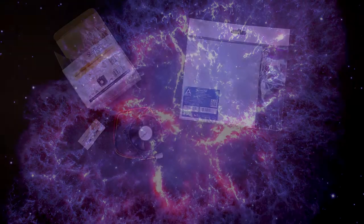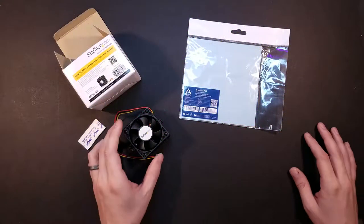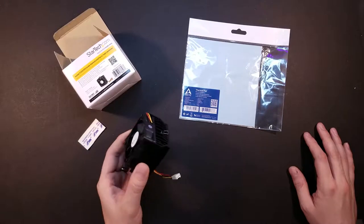So we're going to make sure that the BIOS is set up correctly, and also double check the DIP switches for the CPU that I'm using, and go over that a little bit. And then once that's complete, we're going to go ahead and install Windows 3.11 and DOS 6.22. And we're going to hope everything goes well and get Windows installed and see if we can check that out. So let's get started. All right, so here is the fan I chose.